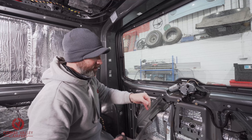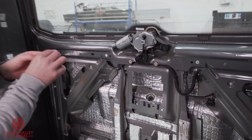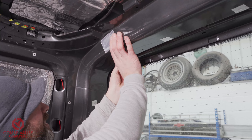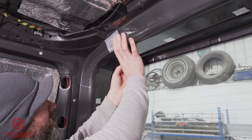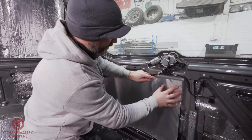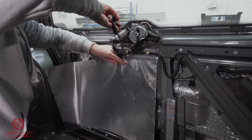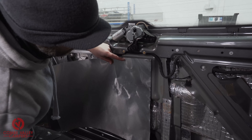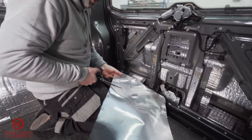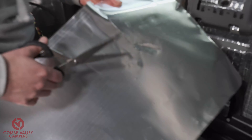I'll do that now. This big square down here — like I said at the beginning — I'm going to show you how it covers up. This is a demonstration for when you're putting speakers into a door and you want to keep those sounds within a door panel. So what we'll do is just roughly mark that out and use the scissors — don't forget, be very careful because those edges could be sharp.